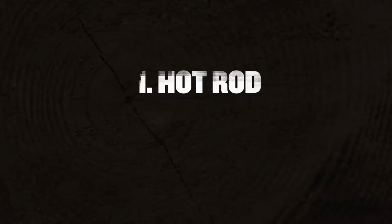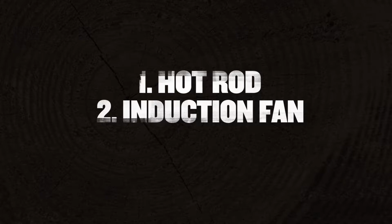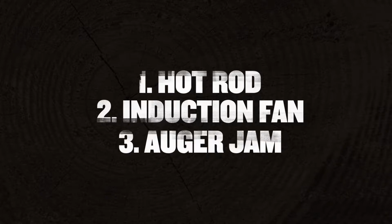Today I'm going to talk to you about why your grill may not be lighting. There's three main causes. The first one is your hot rod is not heating up. The second one is your draft induction fan may not be spinning. And the third reason could be your auger is not feeding pellets to the fire pot.